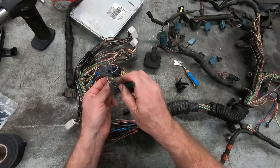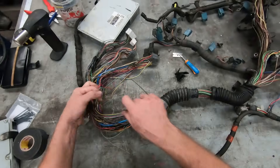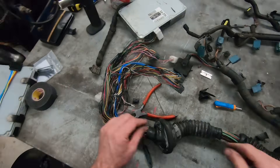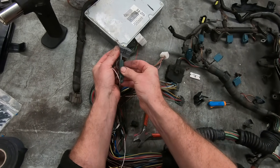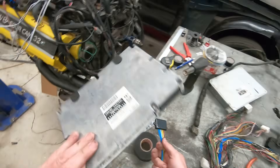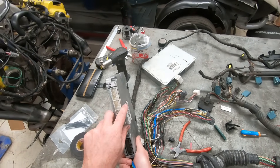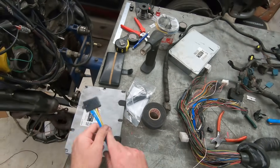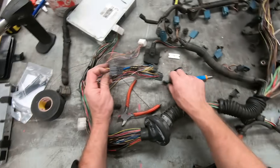In standard form the VVT-Is produce more power. The standard computers are newer and better, I think. Though I still don't mind the old ones, and some I will still choose an older engine for simplicity. With the VVT-Is, if you have converted it to manual and you are not running some sort of box to emulate the transmission — here's the VVT-I ECU, quite different in design — if you're not running some sort of box to emulate the transmission, you don't have a VVT-I. You have a non-VVT-I engine.